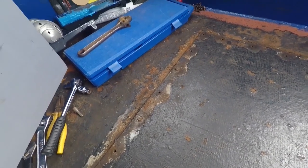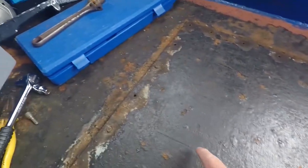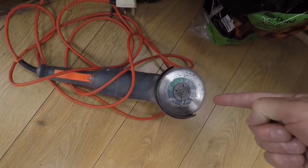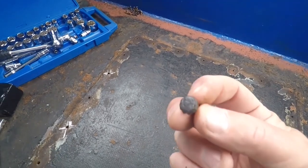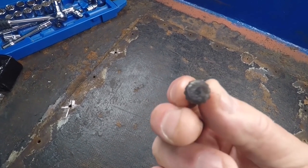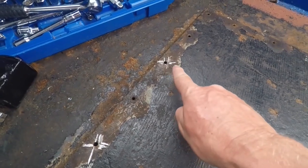This water tank has proven to be very difficult. All the nuts are out but there are two stubborn ones. So it's time to bring out the big buffer. The idea with the grinder was to grind a slot in there and use it like a screw so we could just get a screwdriver in and undo it, but it didn't happen. So we had to grind both off.